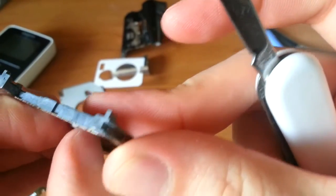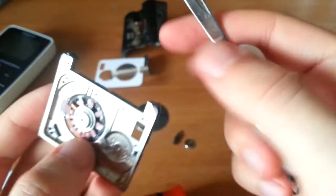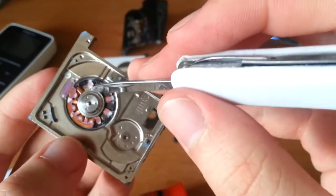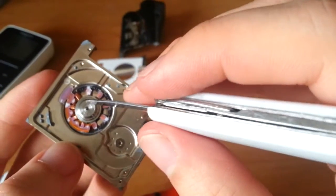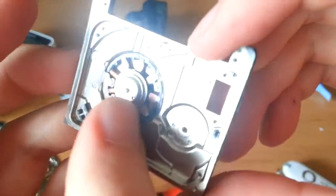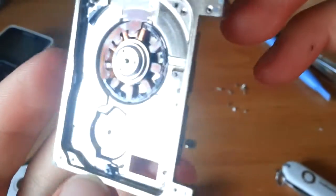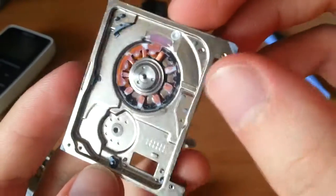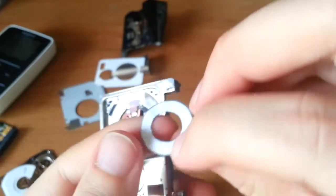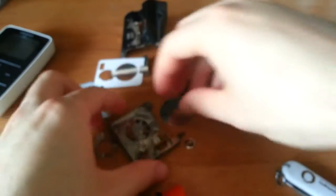And these coils pulse in such a pattern that they can rotate this central hub, which is pretty cool. They usually require some sort of feedback so that it can tell the position of the rotor so that it knows which coils to turn on or off. But there are other methods of driving it without feedback. But yeah, that is really cool there. And there's a little tiny flex cable in here which connects to all the coils. Tricksy. I thought I had to remove the entire thing, but no, there's a little sticker over it. Metal sticker thing, whatever. Really ingenious, though, the way that this all came together.